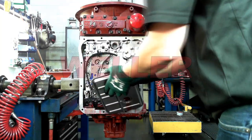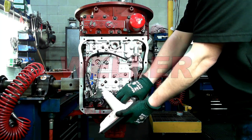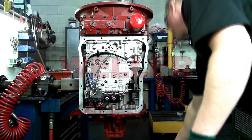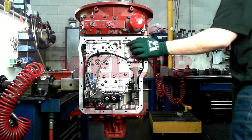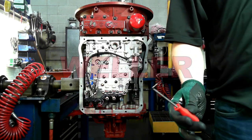Next, remove the internal oil filter. Oftentimes the orange filter seal remains in the transmission main case, so make sure to take that out and put it back on the filter to prevent a double seal. You can use a flat screwdriver or an o-ring pick — just make sure not to gouge the seal surface on the main case.